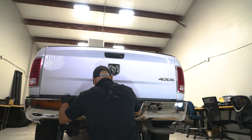With that plugged in, grab the other end of the harness — there are two connectors on there. Run this over to the driver's side kick panel area. Going up through the opening below the radio, the wire comes out right below the driver's side AC vent. Drop the wires down in that direction and they'll pop out below the dash. Up underneath the dash, aim toward the key cylinder area and pull the slack through.